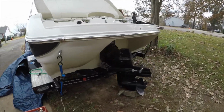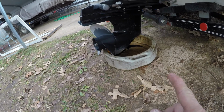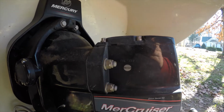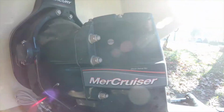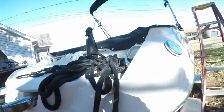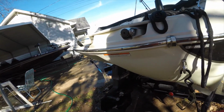Okay, yeah, you're doing a fluid change on these guys. And there's just the screw hole down on the bottom gear. Okay, when you're draining the oil, there's a vent screw. It's on this side. So you can open that up. I chose not to. You could do this a couple ways. But then down on the lower unit, you got the drain plug, and then you got your reservoir. So you take the reservoir cap off, dump all that, and then dump it out of your lower unit. It takes a while to do.